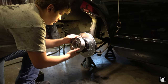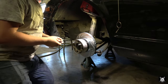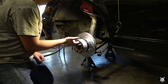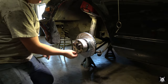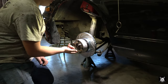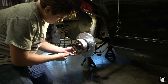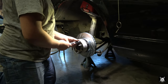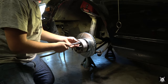Now what Matt is doing is he's putting the original wheel spacer that came with the car on it. Now this car is a four lug car, and these spacers are four lugs. It's about a 2-inch gap that they're creating between the rotor hub and the wheel. We're not going to use the original wheels that came with the car. Simply put, they don't fit, and the tires are very old, and in my opinion, quite unsafe. But for what we're doing right now, it'll work because we're not going to put the fancy wheel adapters on. Since we're just doing preload, we're just going to put what was on there now. That way we could feel the bearing play and then take it back apart after assembling of the brakes.